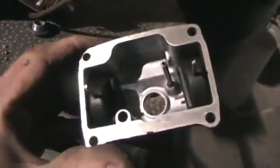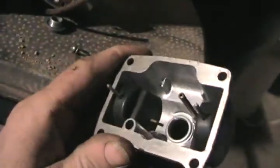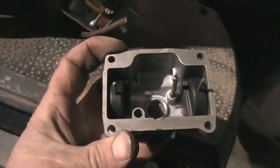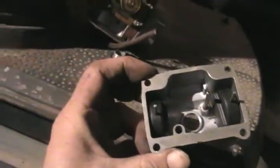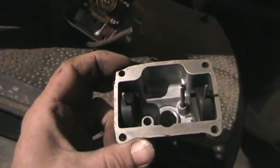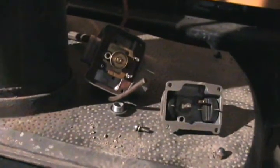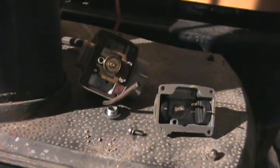If it is all gummed up in here, unfortunately that stuff you buy in a spray can called carburetor cleaner and lubricant isn't very good. You can take everything apart and get a little bit of steel wool in there, a screwdriver to start scratching around, add a little gas in there to soften it. But the very best stuff is called Gunk. It comes in a metal rectangular can, usually. It's extremely smelly, it's extremely corrosive to your skin, it even eats rubber seals and plastic. So be very careful using it and use it outdoors. Even if you're wearing rubber gloves, it'll just be a short while before it eats through them. Best way is to hold the carburetor with a pair of pliers, put safety glasses on, and get a toothbrush or a little stiff-bristled paintbrush and start brushing everything clean. Definitely keep the stuff away from your clothes too, because it'll stink them up so bad you'll never wear them again.